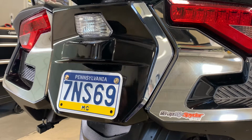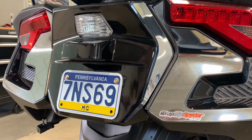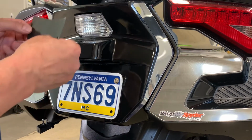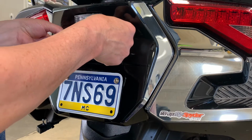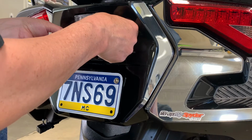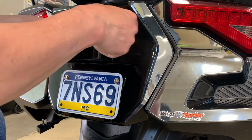In any of the wrapping film that we're going to provide to you, you're going to be able to apply it dry. We've created these pieces so that they will install within the panel, so positioning is reasonably easy. With the reflective, it's a little tackier. Manufacturers really don't want us to apply reflective wet, so we usually try to do that dry. Could you apply it wet? Perhaps, but if you can do it dry, that's always better.